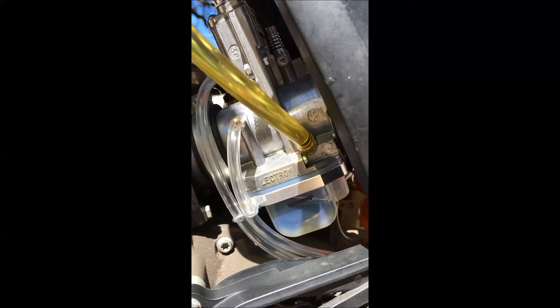Right now the bike is level on the ground, but the carburetor is not level. I've seen some videos where people say 'wow, that's too full' — well, it's not really that full. The reason it looks that way is the carburetor is crooked. If that carburetor was level, then the fuel would be at the correct level.